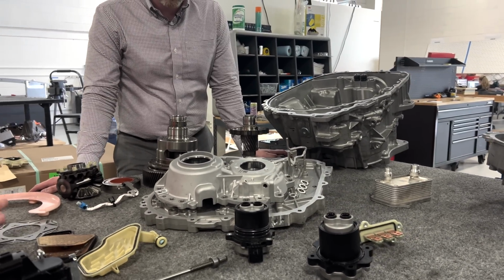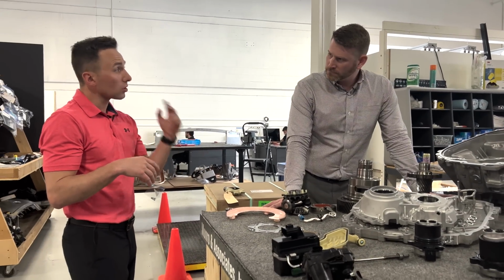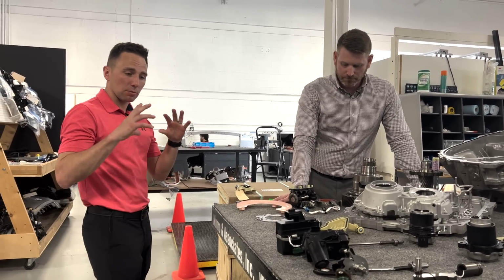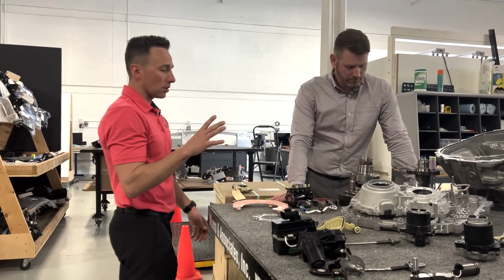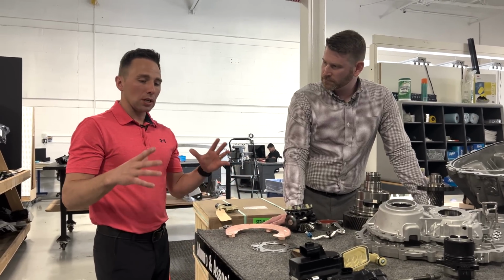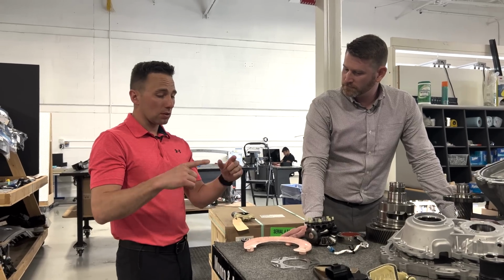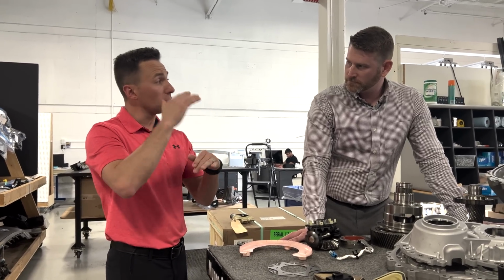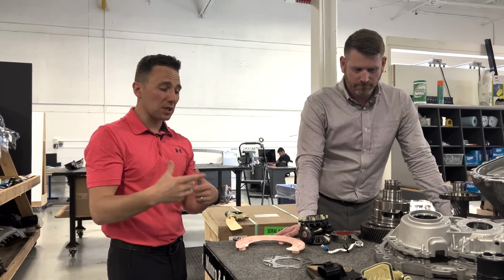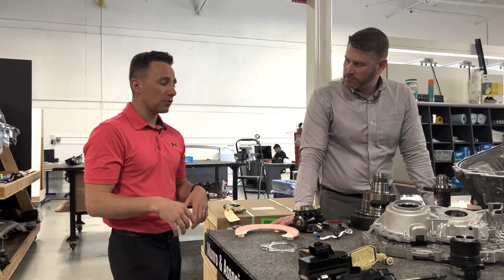Obviously, it is tuned to being able to, a lot of folks think about, well, the Lucid produces equally as much torque, right? And for sure, in terms of output torque, but there's another type of torque or reaction input as you're driving. A lot of tests and driving conditions will simulate the wheels and tires spinning, losing ground contact, and then making ground contact again where the wheel speed exceeds the ground speed or vice versa. And what that does is it shocks the driveline unit.